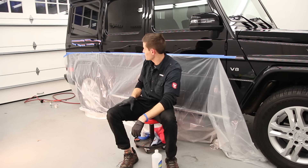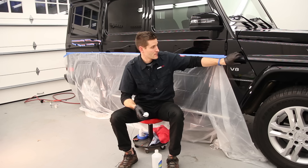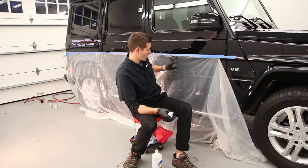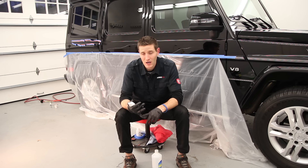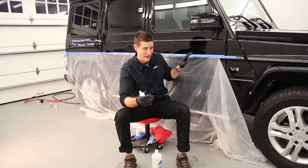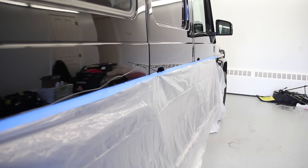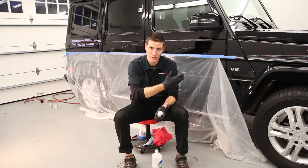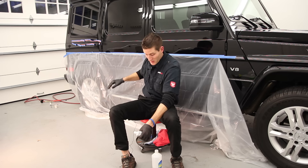After it was completely dry, I started setting up my drop cloth. The reason is there's rubber on the actual car — little rubber parts on the G550 that react weird to waxes. It's in a funky area, right in the middle of the door. So my plus-minus thinking: how long is it going to take me to cover this, and how much does it cost? It cost me four dollars and took me ten minutes. Based on the price of the car — $120,000, $130,000 — sometimes you've got to use your head and say, for ten minutes, I'm just going to avoid any problems. Is it overkill? Maybe a little, but I think that's why a customer like this might want someone like me working on the car.